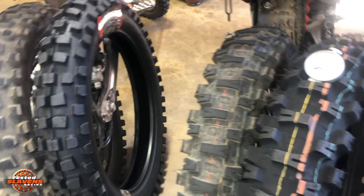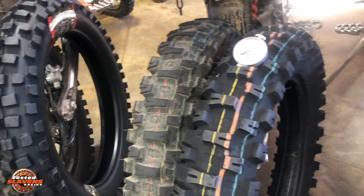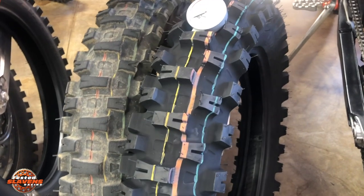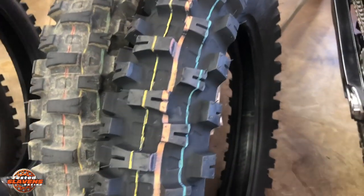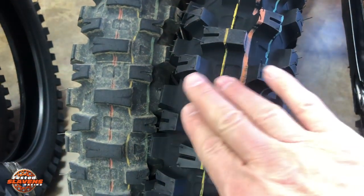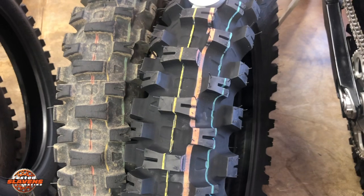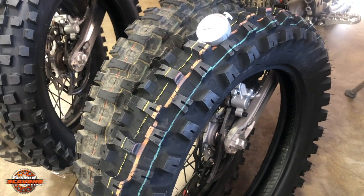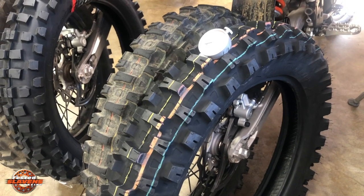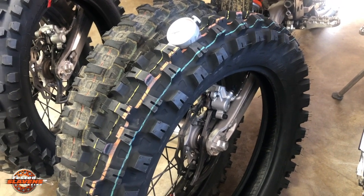Now all these types of tires are called hybrids. These hybrid tires typically have a reasonably stiff sidewall and then a flexible crown — this is the crown area — a crown that you can push in fairly easily. That flex gives them more traction. It's not just the rubber compound, but also the carcass construction that gives them more traction.